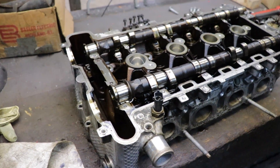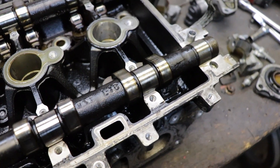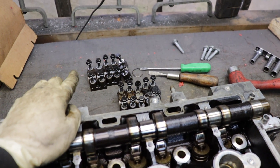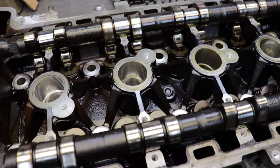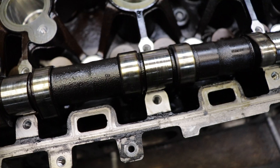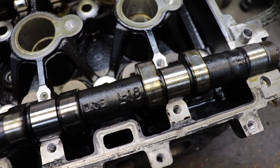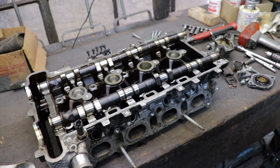There's no obvious distinction right now as far as intake and exhaust camshafts, except for different numbers — but unless I write them down that's not really gonna help me. The caps one through five are on the exhaust side — that's the first half — and then six through ten is the second half. The intake cam has a B stamped on it right here. So in my mind that'll make sense because it'll be the B side as opposed to one through five and six to ten. I'm gonna write these down too to keep track. Before you do it, just make sure you know which ones you're taking out and where.